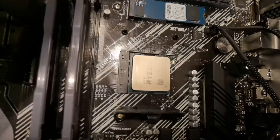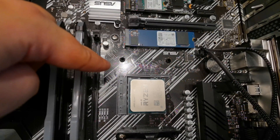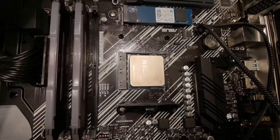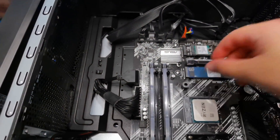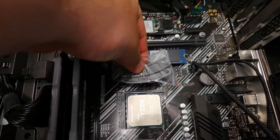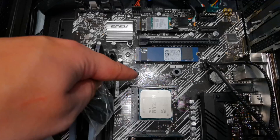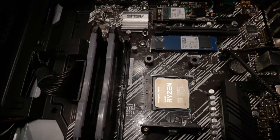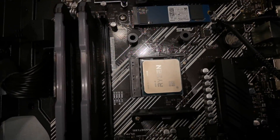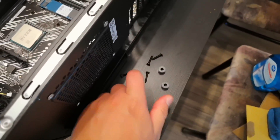So at this point I remove like half of the OEM brackets that come with it. They clean the CPU from thermal paste - you don't want to keep it. It comes with thermal paste, and their thermal paste is pretty decent. So there's one way you could mount it without having to go behind the case, which is kind of annoying if you're alone. You could place these - technically to install it you have to put these brackets. You could put the bracket right away, start screwing it, and that would hold the back plate meanwhile. But I prefer to do it properly, without chances of tightening something too early and unevenly.